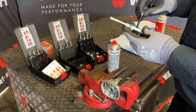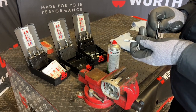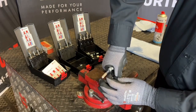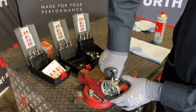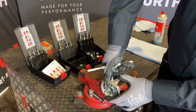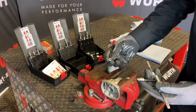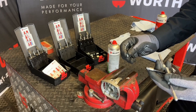Next is your seat cutter. The seat cutter or collar cutter cuts a little bit away on the top end so that you can fit your Timesert perfectly. It will not go too deep because there's a stop on the end. It's very easy to see whether your collar is deep enough to take your Timesert — take it upside down and see that it's a perfect fit.